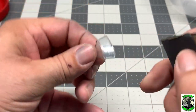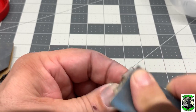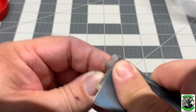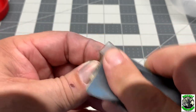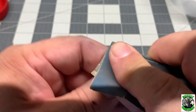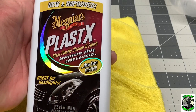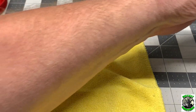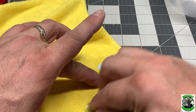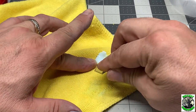Now it's time to address the scratched-up windshield. I've got some very mild grit sandpaper — 800 grit. We're going to smooth it out as best we can and get rid of a lot of those surface scratches, then follow it up with maybe 1200 grit or even a little higher. Once you're done smoothing it out, use this plastic polish — I got this Meguiar's polish at a local auto supply store and it works really, really well. Put a little bit on and start rubbing it down until you get a nice, super smooth finish.